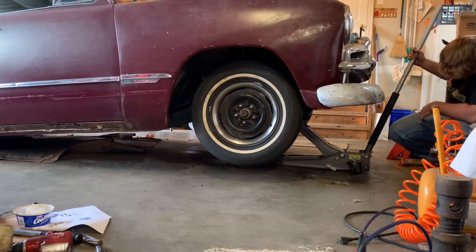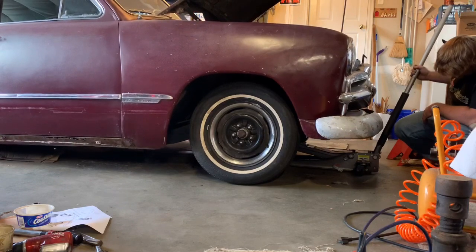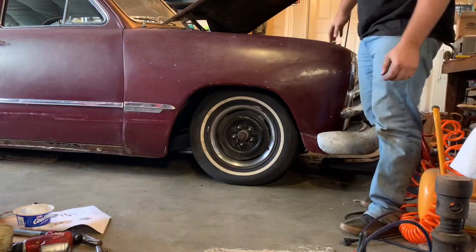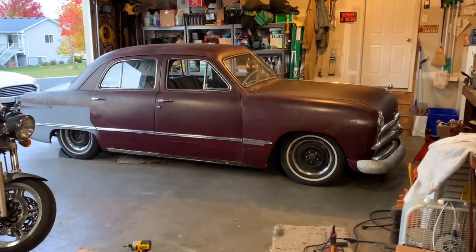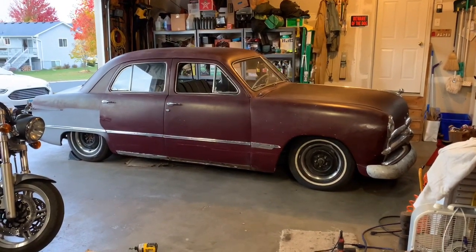I've got the jack stands pulled — let's see how it looks. I shut the hood for the full effect, and I am super happy with how this turned out. This looks amazing. I just grabbed the tape measure and took a few measurements: we are at 24 inches in the front now, so that gave us about a three and a half inch drop, and the rear is sitting about half an inch lower than the front. I am incredibly happy with how this turned out. If this video helped you at all or if you liked the car, please give the video a thumbs up and consider subscribing. Next time we are going to get those brakes figured out and take this thing on a test drive. Thanks for watching and I'll see you in the next one.